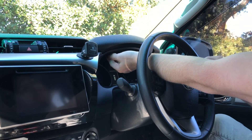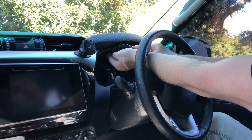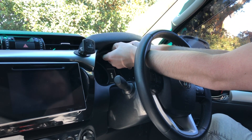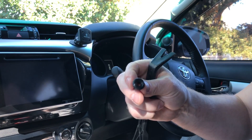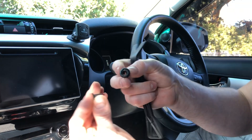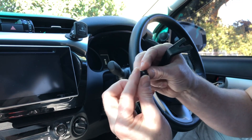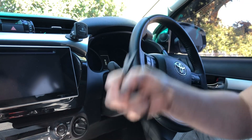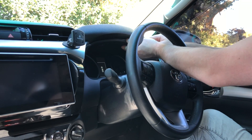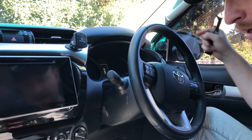That will leave a center piece in there still, so when you remove the next part, cup your hand under the section so it won't fall out. Take your non-marring pry bar, slide along the top, press in and push down, and you'll hear a click. Pop out the scrivet — the little screw pushes in and locks in place, so remove the center and that bit will pop out. Use your pry bar and pop them down — just make sure you don't drop them as they can be hard to find.